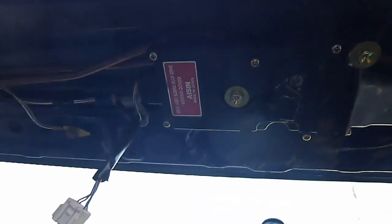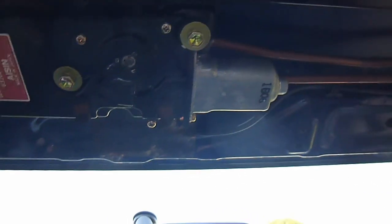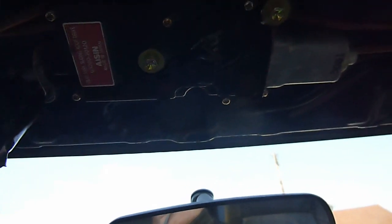I've taken all the old sunroof off, put it aside, took the motor off, cleaned it all up and kept my fingers crossed. I took the motor out, had it disconnected from the frame, and the motor spins around fine — so there's no issue with the motor. After spraying loads of WD-40 and trying to clean out these tubes with the running gear in them, it still doesn't work. I think it's just seized up basically.